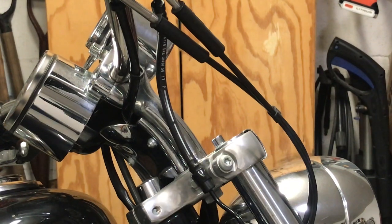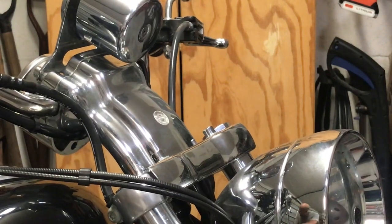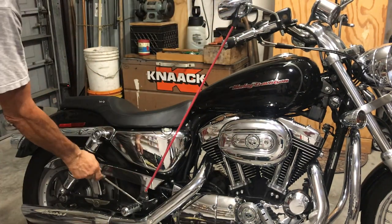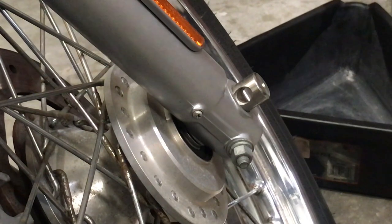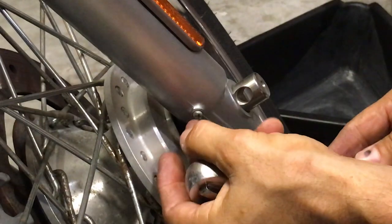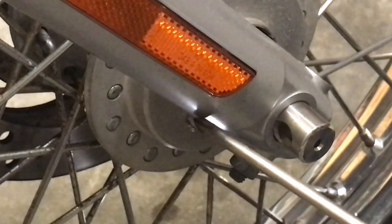What I'm going to do now is turn the wheel and take a bungee cord. I put the bungee cord on the mirror to my rear foot peg. For the purpose of doing the video I turn the wheel back. You'll notice this is a little drain plug right there — it's a Phillips head, a standard number two. I'm going to use it on a ratchet. Now I have the wheel tilted and this has already been loosened.